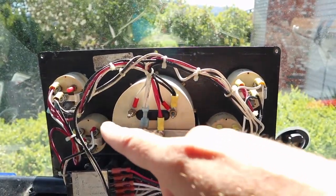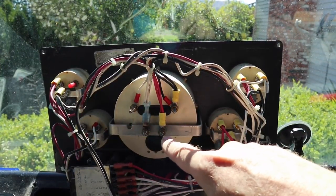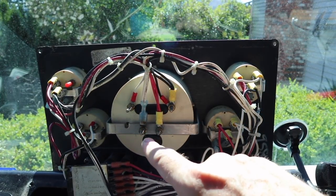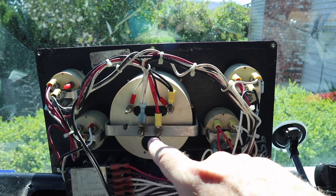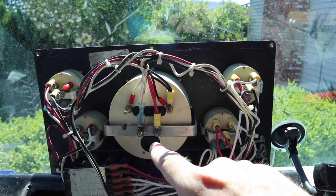Since then I've been trying to do some troubleshooting. A day or two after that I pulled apart the dash and looked underneath. Here's the underside of the dash - over here is the speedometer, this part is the odometer, and there's no speedometer cable, it's fully electronic. I pulled off the ground wire, used 200 grit sandpaper to clean up the connection, and added dielectric grease and put it all back together.